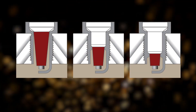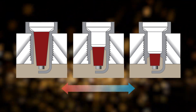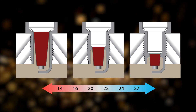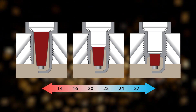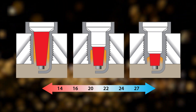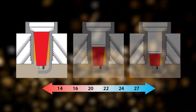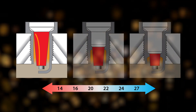These cutaways show what physically changes on a spark plug to affect its heat range. By simply looking at a normal plug that wasn't cut in half, it would be difficult to know what the heat range was if it were not printed on the side. From this cutaway you can see the change in length of the ceramic insulator and the amount of air or gas pocket that there is. Low heat range applications requiring hotter plugs have a longer insulator and a larger gas pocket.